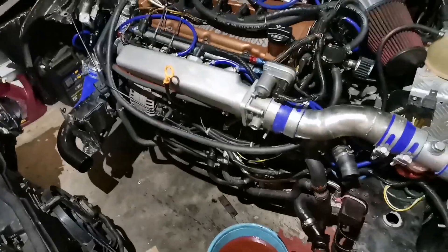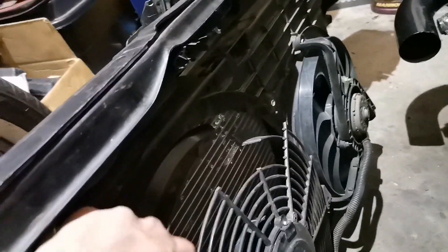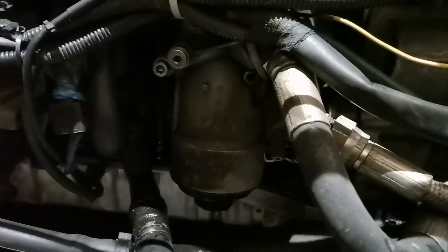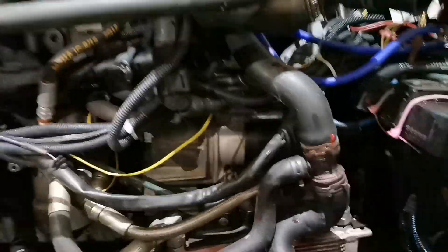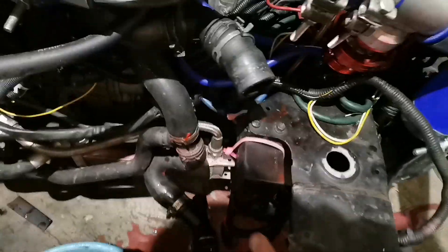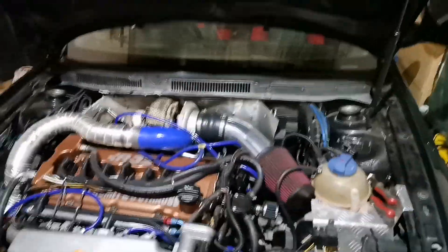So guys, this is how far we got on day one. What we can see is we have a coolant leak over here, so we need to fix that on our radiator. The fan must have broke and caught something — completely broke loose, so that we'll have to fix. We can see it's a little bit wet over there from the oil. I'm not sure whether that's the dipstick — you can see it's a bit wet there. So our coolant definitely has a leak somewhere.